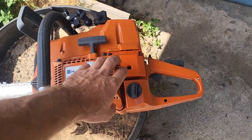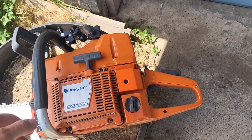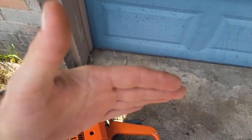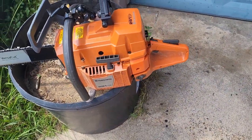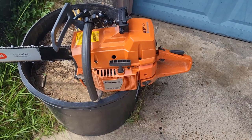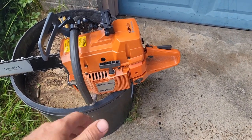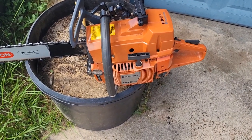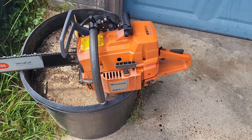The next thing I'm going to do with it is go in and see if there's room to raise the intake roof, not the floor. In these, instead of the roof being flat, it's flat about halfway and then angles down real hard. If there's room there, I might try raising that about a millimeter at a time. 77 is still relatively in line with things as far as the intake timing, so I'll leave the floor where it's at and then try and raise the roof and see if that does anything.